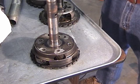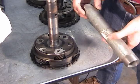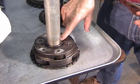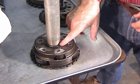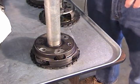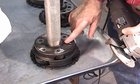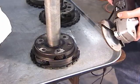I'll put my safety glasses on. I'm also going to take this one and a quarter inch galvanized pipe and put it on the output shaft, just like that. That'll protect the machined part of the shaft. Sometimes when you're using the grinder, you can accidentally go up there and put some burrs on it, so that protects it. I've already got the abrasive wheel on my grinder. We want to take that stamping away but try not to take too much material off the hub.